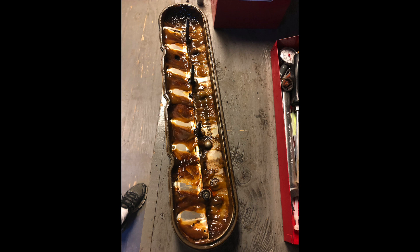That's not good having that stuff rolling around inside the engine. You kind of want to catch this as soon as possible so you can save the rest of the motor. You're going to notice the lifter noise — the lifter noise is obviously caused by the sludge clogging up the hydraulic lifters and not allowing them to get the oil they need to stop all that racket.